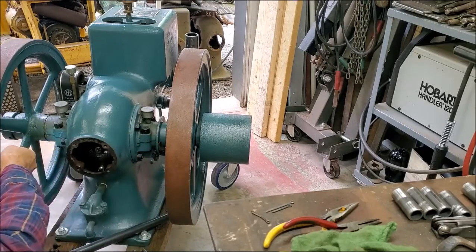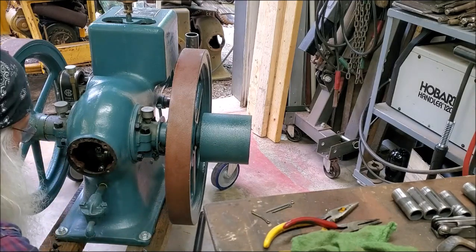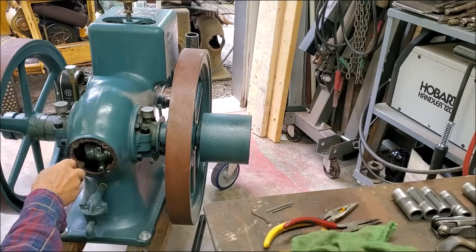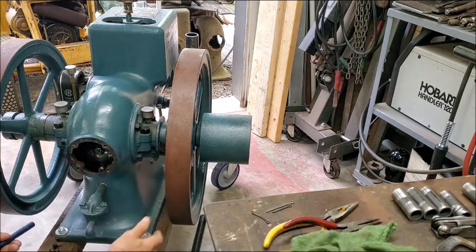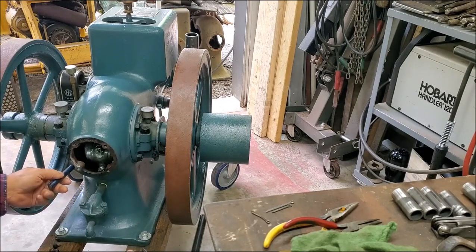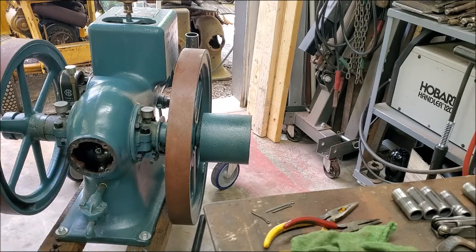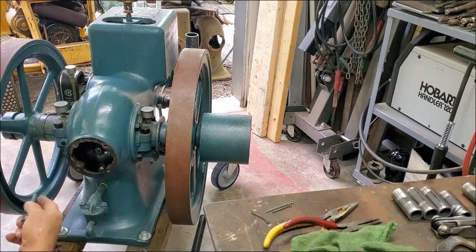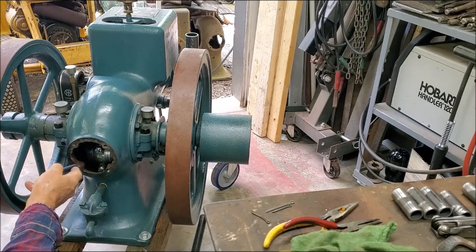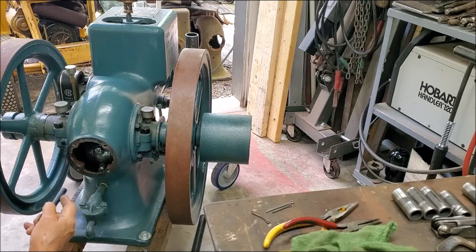Well, we'll have to see to that — that's different than this in here. When I turn that flywheel backwards and forwards and look up in there, I see that rod bearing edge and the crankshaft. That makes a loud pounding noise in these engines. This one I put these in the other day, and I've already took a couple out working down to where it should be. They're worn so bad it'll just have the big shim in it, I think.